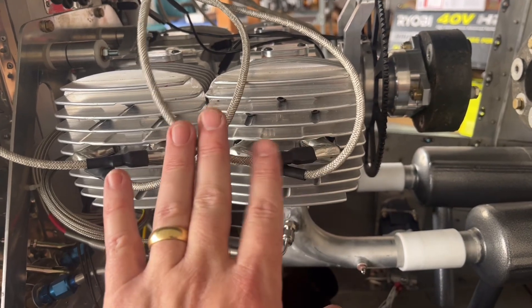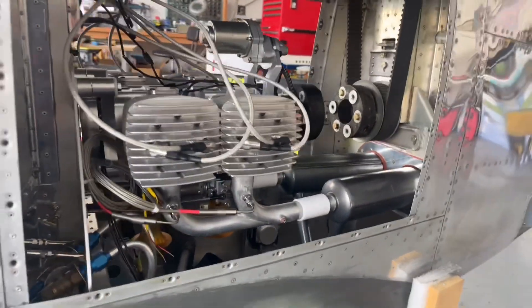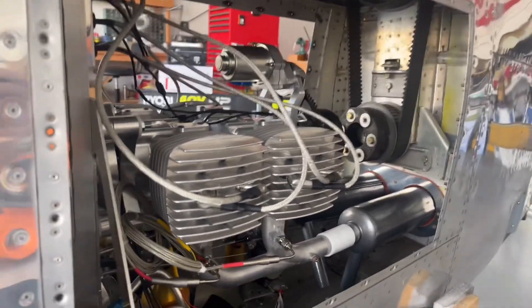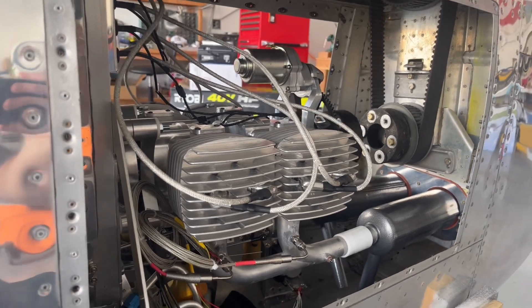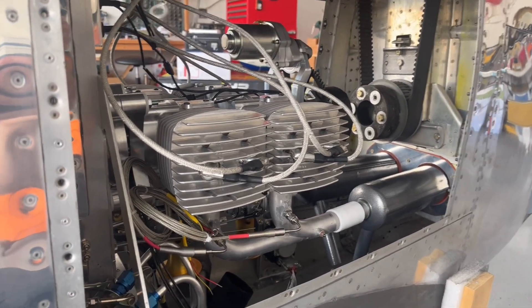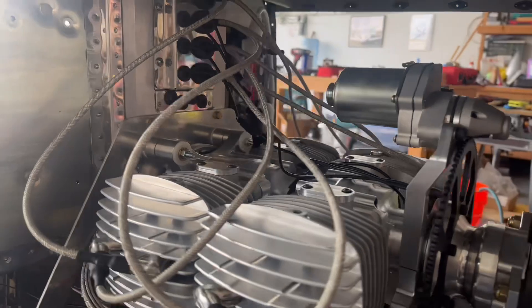I'm still concerned that these might be just slightly in the way, so I've got to look into some ways of getting these so they don't chafe against that engine cover - or actually even building a small bubble right along that part that hopefully doesn't interfere too much with the airflow over the horizontal stabilizer. I know the guys that have put larger bubbles here to accommodate a wide boxer engine have really created burbles into the elevator system that people don't like. But you can see how it's really coming together.